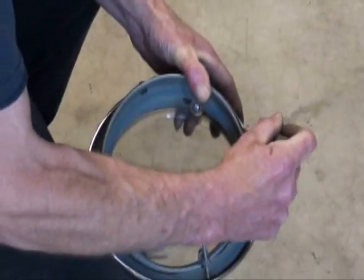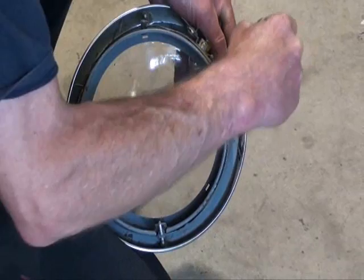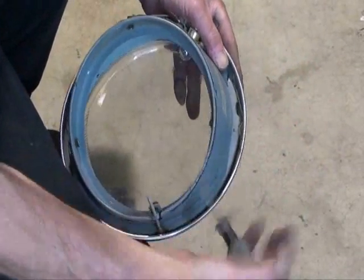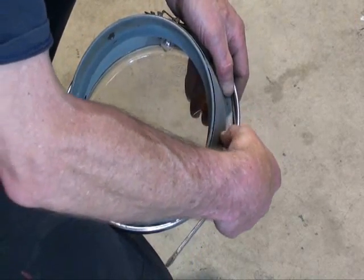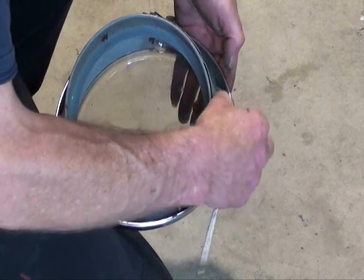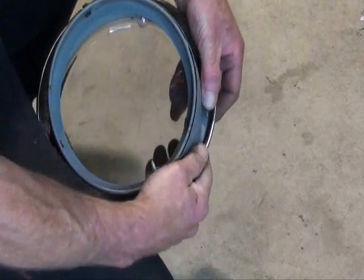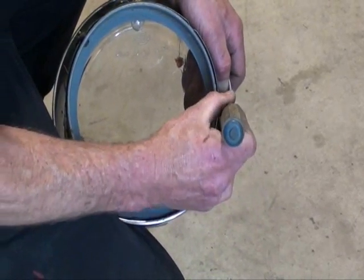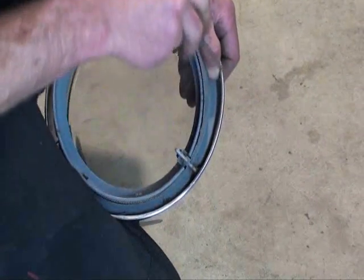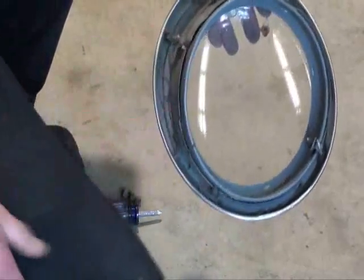These are kind of odd headlights, and if you've got to change the bulb in them the first time or two that you do it, it's kind of a chore — you've got to figure out how it goes together. I'm going to rotate that around just a little bit to another location and see if I can get it to pop in there correctly. I think the problem with the spring is it's in backwards. There we go — that's the ticket, that'll fit and actually hold it in place better. That holds the lens and the bucket assembly in a better fashion.